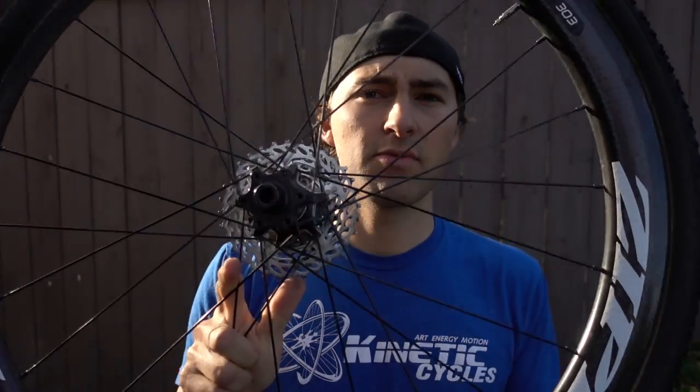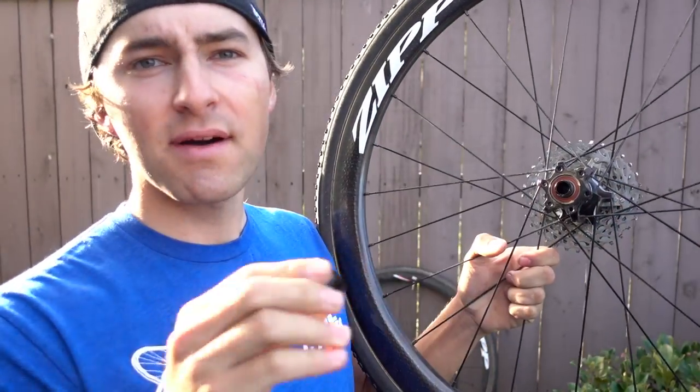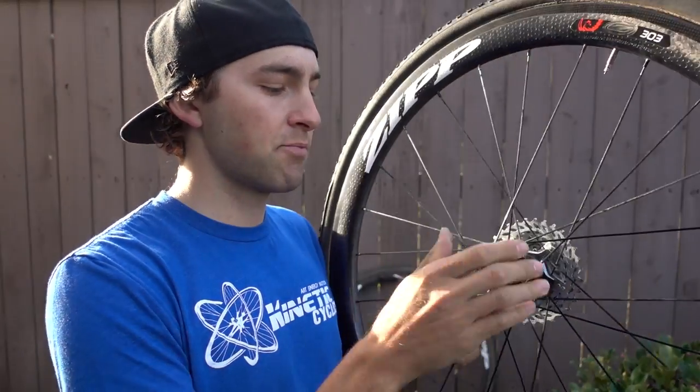Both wheels have the three-axle option, which is super cool. We can run 12x100 on the front, quick release on the front, or 15x100 on the front. You can run a quick release rear, 12x135 rear, and 12x142, which is what we use. These wheels are super convertible — I can pull the end cap off, slap it on, and I can put a quick release on this and run it on my single speed. Or I can swap to a 12x135 — I have a 12x135 spaced Crux that I use for training and gravel grinding. We can interchange these wheels or hubs on any bike we want.